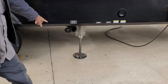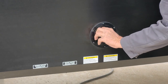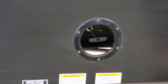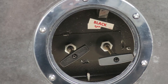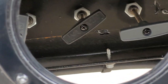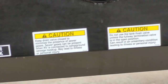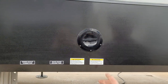There's another sewer dump valve back here in the back. Going through the piece of plastic on the bottom skirting, there are three handles inside — a gray handle, a black handle, and a second gray one. The first gray one is your bathroom sinks. The black handle is your main bathroom toilet water, and the second one is for your washer-dryer prep. This access panel lets you get to the valves without going up underneath the metal.